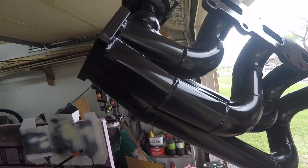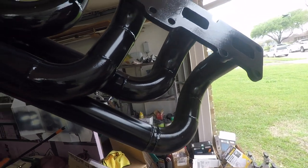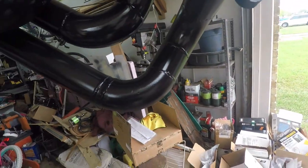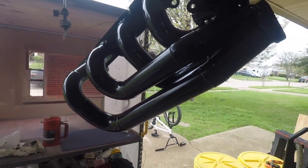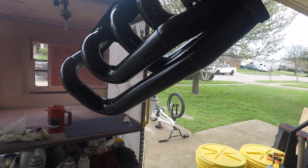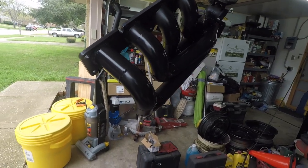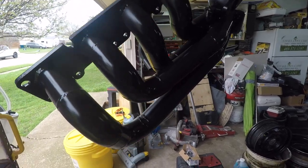Now this obviously is still shiny because it's still wet. This is the air cure, so this will take 45 minutes to an hour. Man, those birds are loud. 45 minutes to an hour before it's tack free. And then it air cures for 24 hours. It'll be partially cured then, and then it's fully cured after about 5 days. From my understanding, and what I've read and watched, you can install these at that 24 hour mark, and then it's good to go.